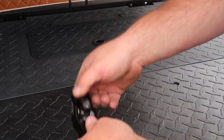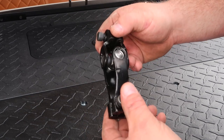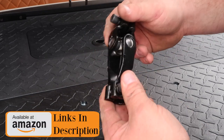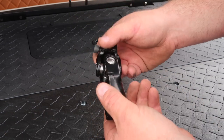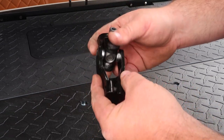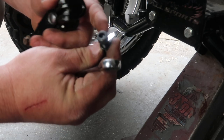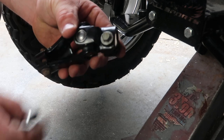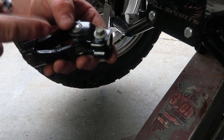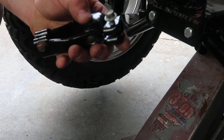Let's compare this to the new one. So this is the new one here, and as you can see this one's good to go — this is the one we're gonna put on the golf cart now. I got this one on Amazon and I'll place links in the description below in case you have a yoke that's doing the same thing. It was relatively cheap, 29 bucks or so. On this new yoke it had these allen head bolts in it — I removed those and put these older 10 millimeter style bolts in from the old yoke, and they work fine.